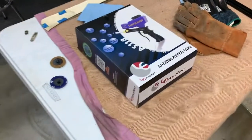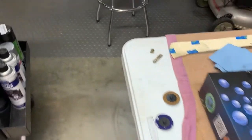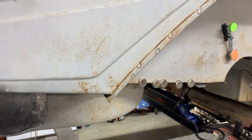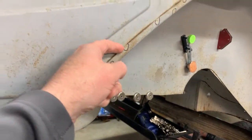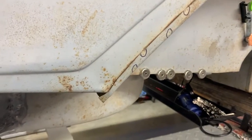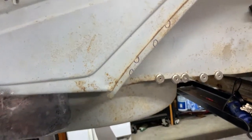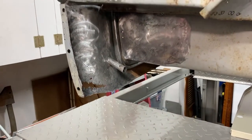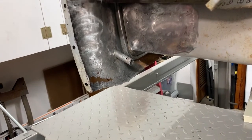One thing I wanted to mention — I picked up a sand blaster gun, just a spot blaster. My goal would be to use that to repair some of the sandwich rust in these flanges. For example, this one here — I can tell there's some mud and rust in there. My plan is to drill out those spot welds, pull the flange back, blast out the rust, and then close it back up with proper primer. All this looks okay now — I managed to get most of that surface rust out and dug out of the pores.